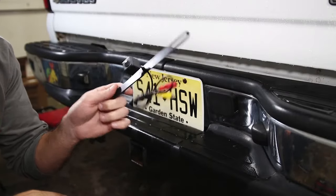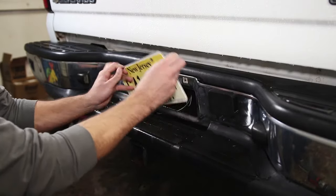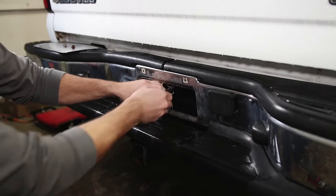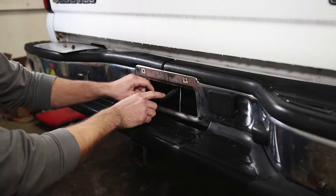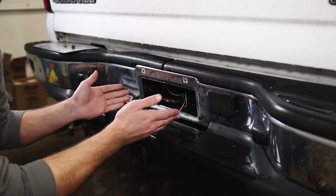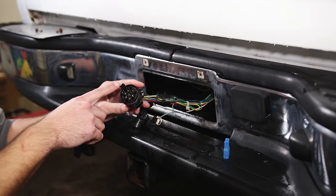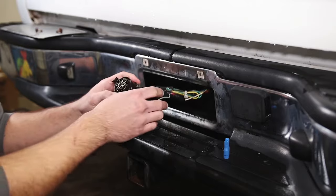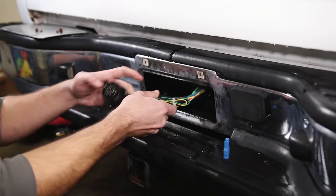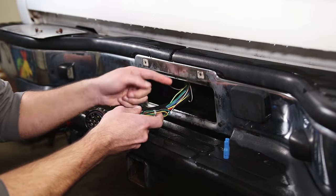To physically mount the camera is very simple. With the license plate removed we now have access to the harness for the trailer connections — this is where the wire that we're going to tap into is. If you don't have this trailer wiring connection you can just simply tap into your reverse lights. This is the plug for the seven-pin trailer connector that is already part of the Silverado, and we needed to identify what the reverse light was connected to — which color wire. We found out that the light green wire on the truck is the reverse light.